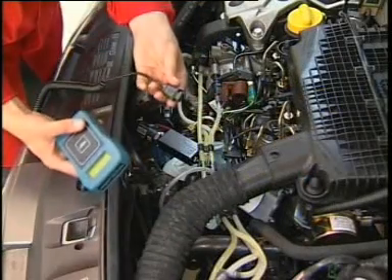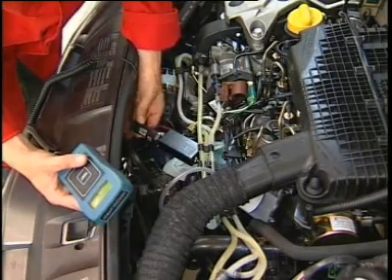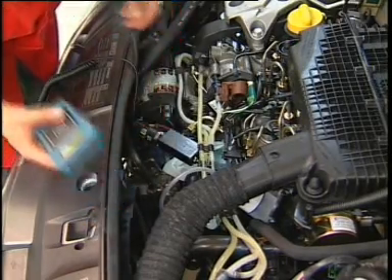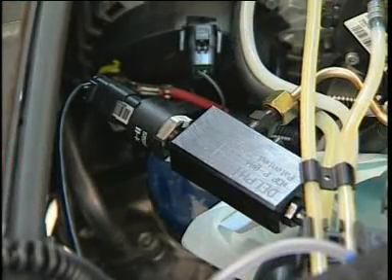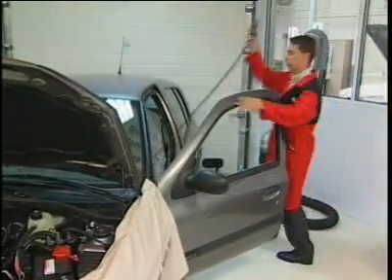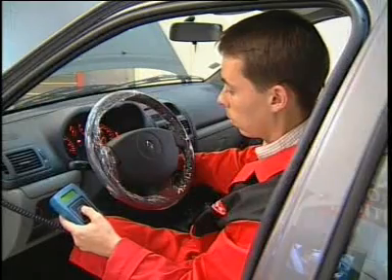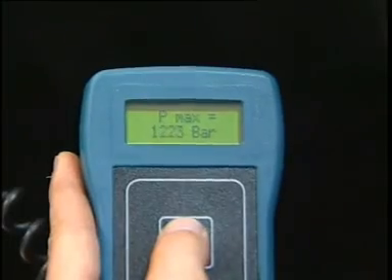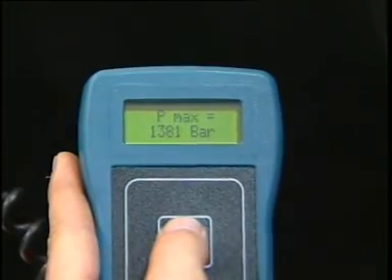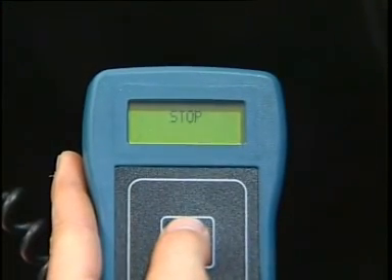The pressure display is connected directly to the test rail sensor. Its flexible lead allows the test to be carried out by a single person. The technician activates the starter until the maximum pressure value has been registered, and the capacity of the pump for generating high pressure is then measured and compared with the test data.